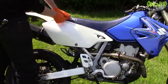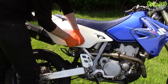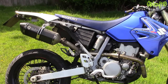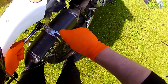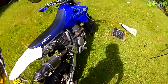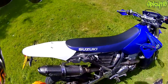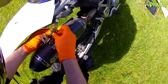We don't actually need to remove that much stuff to do this. I'll pop the side panel off — it'll be easier and help with camera exposure since it's a bright day and a big white plastic thing throws the exposure off. Then loosen the exhaust clamp to get this off. I'm not going to undo it fully yet, just get it very close. Then undo the strap. When we take this nut off entirely — just put that back on so we don't lose it.